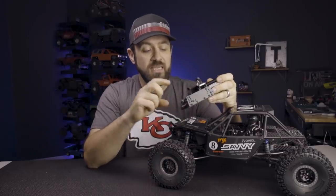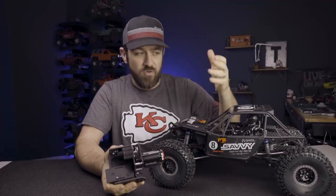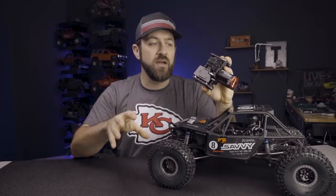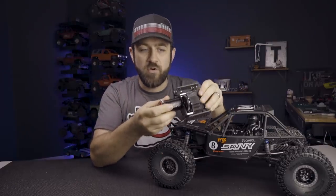The transmission case and the skid plate are both printed through Shapeways, so they're an SLS printed nylon rather than an FDM printed piece like a normal desktop-type printer setup. The transmission is a reconfigured 3-gear transmission, so things are moved around a little bit for optimum placement of this forward motor mount setup.